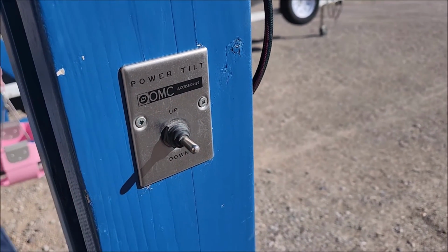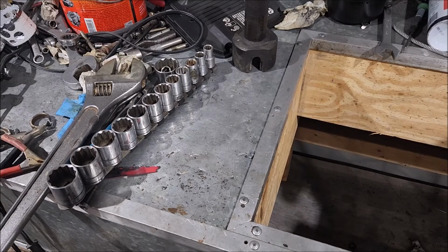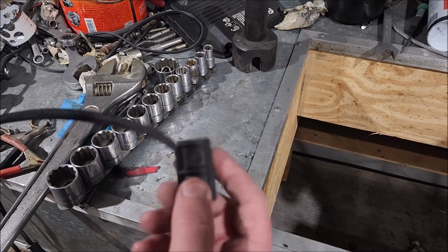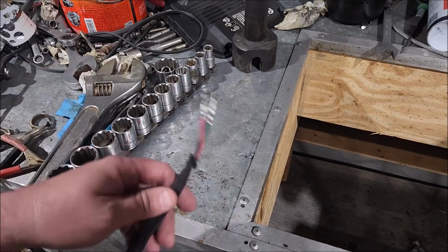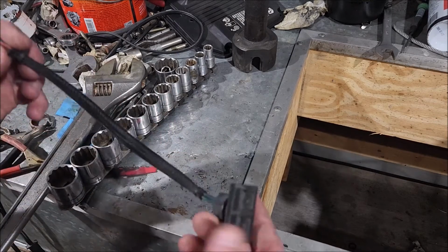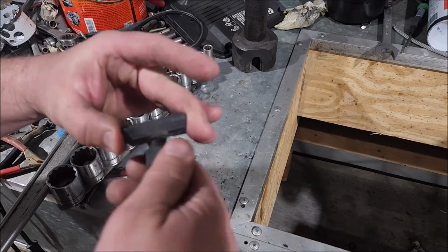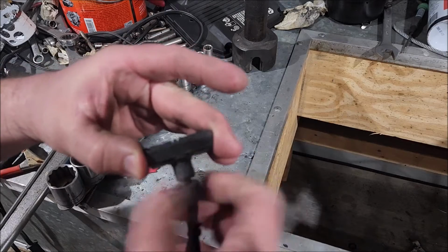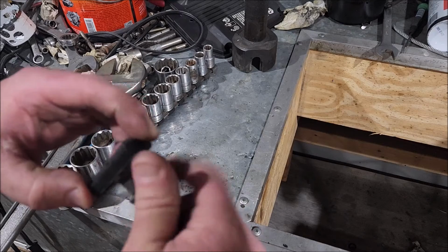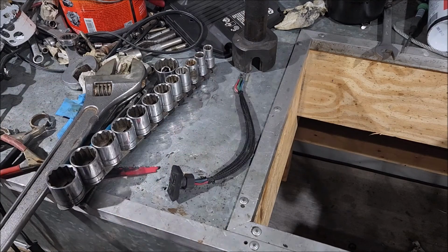You're going to need the switch, and that's where the challenges start. Now, you could get creative here on your switches. Like this would be one of the motor trim cowl switches. You know, standard up and down. You got your 3 wires, again, red, green, and blue. So you could just put a hole in your boat somewhere for whatever size that is, 1/2 inch, and then screw that on. That's one option to do it. That's an OEM way to do it.